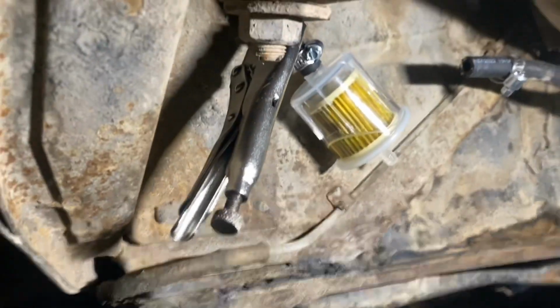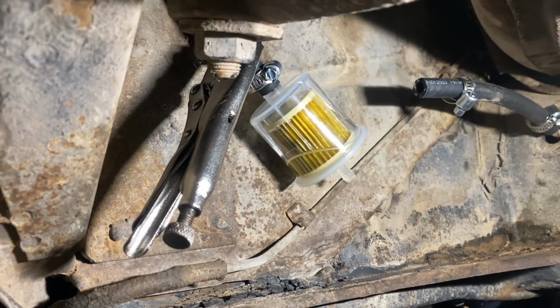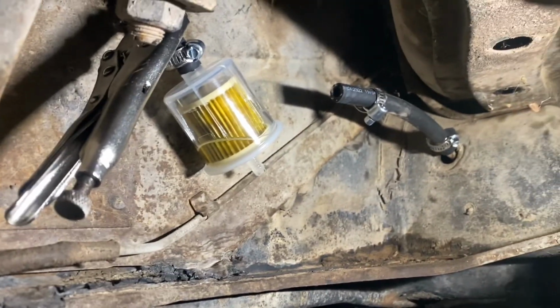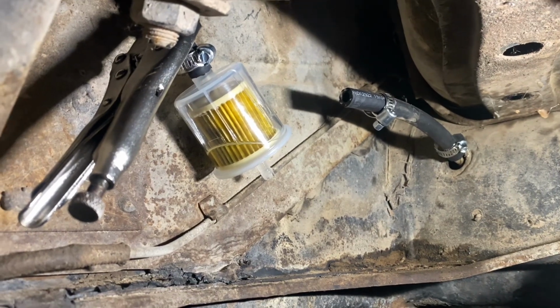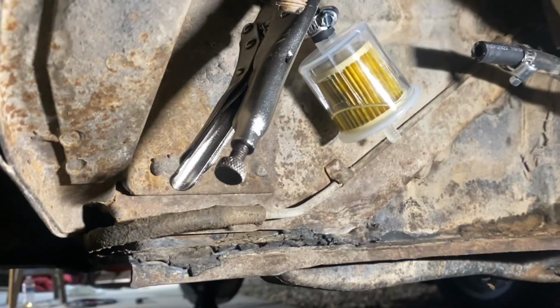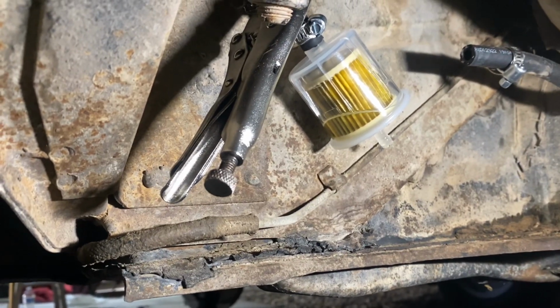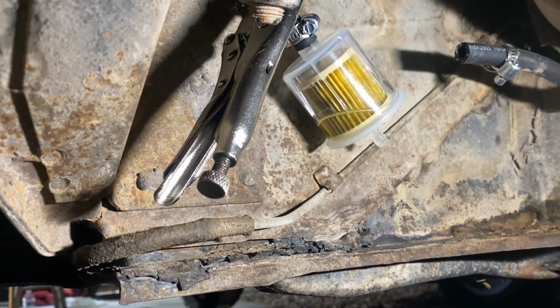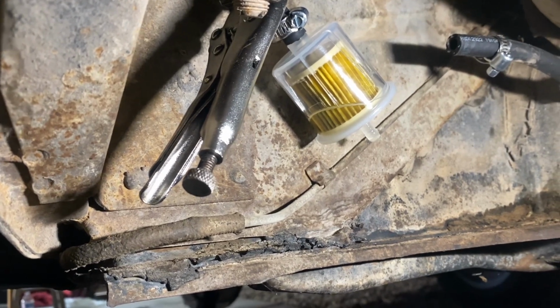So, what I explained was this front fuel line. We clamped it off from the tank. I let it go. It is running out. It's not plugged up in the filter. That line goes down the chassis and back to our motor. My theory is because fuel is gravity feeding from this filter just fine, running right out, there's a situation where the pump is not pulling it